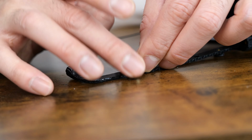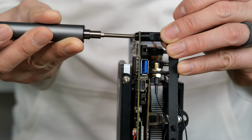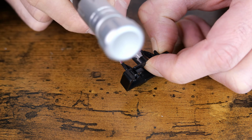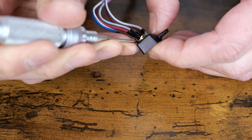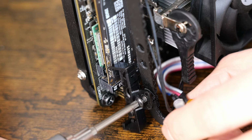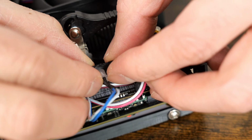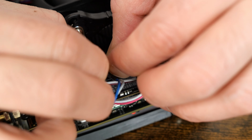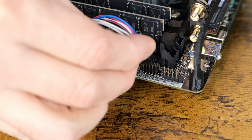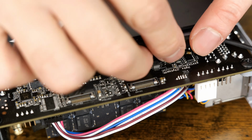If you get bored with this motion, just count to 10 and repeat. This screws to the top front of the motherboard. I didn't want the front LEDs shining to the front of the case, so I decided to face them backwards on the front bracket. They're removed by spreading the clips. The power button then screws into its mounting hole. The front LEDs slide into their holes and are kept in with friction. Make sure not to forget to plug in the power button and LED leads. Then install the hard drive cables like so.